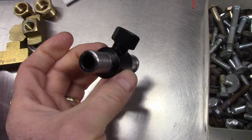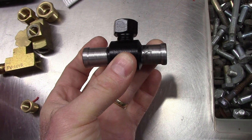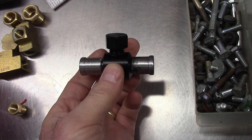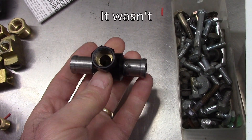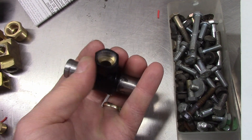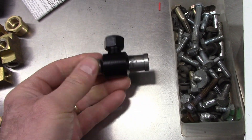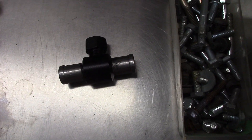Here's the cooling adapter I machined — just out of 1-inch solid, turned down to 5/8ths hose diameter with a 0.7-inch shoulder to help seal it up. Hose clamps should fit on both sides. I'm going to slice the heater hose that comes fresh out of the block, so it should be hot enough to give a reasonable reading. The capillary fitting that goes to the gauge plugs in here — it's a mechanical gauge, not electric. I'll put that in as close to the block as I can fit.